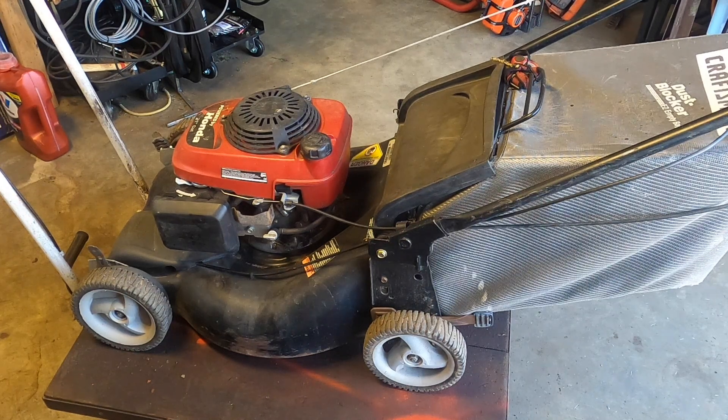The really important thing is to clean it. Carb spray — I would highly recommend also an air compressor — blow through every single area you can. If you have an ultrasonic cleaner, even better. If you don't have an air compressor, it would be wise to just get a can of compressed air and blow through there. You really need to put some air through there to make sure there's nothing left that will cause a future problem. The fuel had no water in it — I took a little fuel from the tank and it was normal.